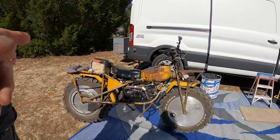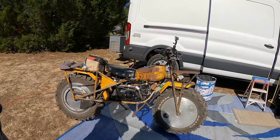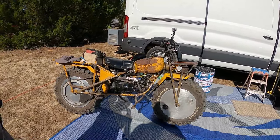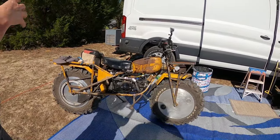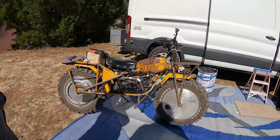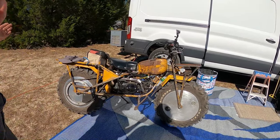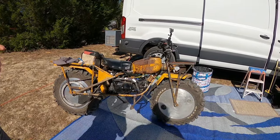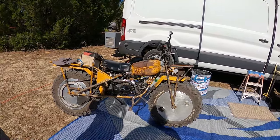Well, that makes sense, because I had an old one that I got running, and the clutch was no good. It didn't move, and I didn't keep it. I didn't even look at it. But what you're saying is a lot of the old ones had clutch issues. A lot of the old ones had clutch issues, and the Mercury clutch that they came out with, that's on the 1965 to 73 bikes, is a phenomenal clutch, but it will fail if the belt is too tight. It's just the little bearing in there can't hold up. Yeah, all right. I never even looked at it, but it was an older one. It was green.